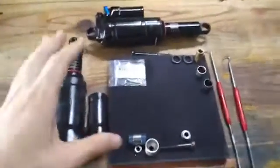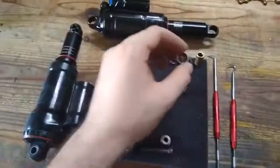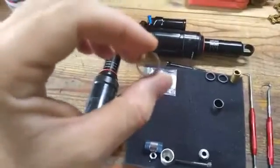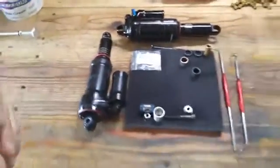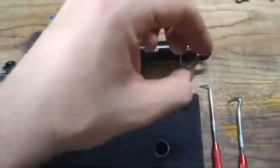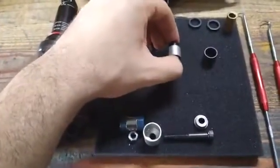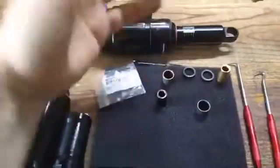In this video, I wanted to talk about some of the options that are out there for your shock. We'll start with regular bushings. This is your standard bushing, what you get out of factory — it's a type of polymer. It'll tend to wear out, and that's when you get play in the rear suspension. People check pivot bolts first, not realizing it's just a small piece pressed into your eyelet that wears over time. That's normally what comes on most bikes from factory.